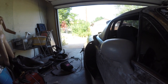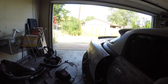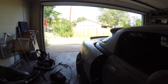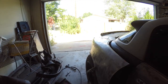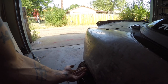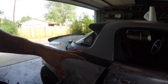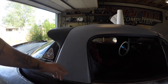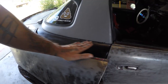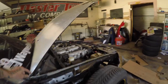Here's where we left off. I'm not sure I'm liking the angle and the width — it seems kind of big, so I may do some adjusting. I need enough clearance for the tire to move up and down and still have everything fit. I'll finish up this side before starting the other to avoid discrepancies. I need to pull the hard top so I can weld in the fill piece without burning it, then make a fill hole and a little triangle to fill that in.